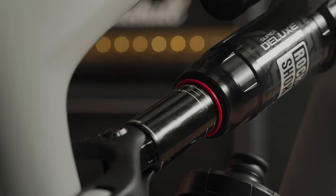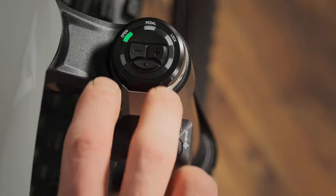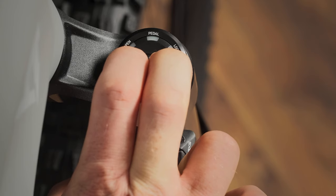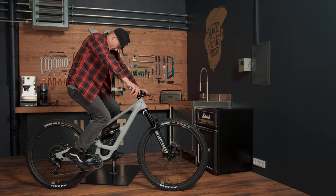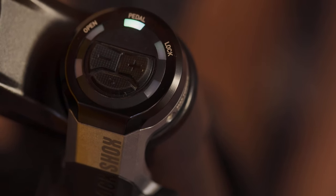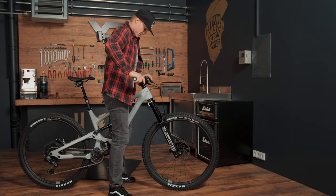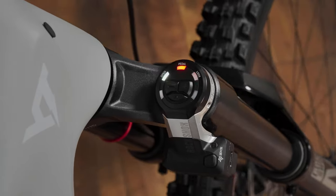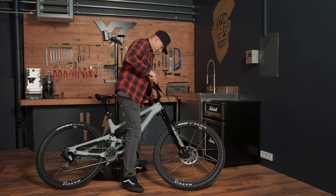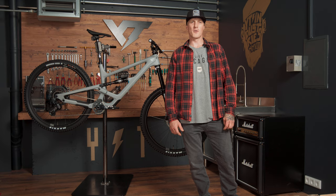Last but not least, we need to calibrate the system. Sit on the bike on a level surface in full riding gear to put both shock and fork to their set positions. Press and hold both adjustment buttons for three seconds until the pedal LED pulses white. Red LEDs during calibration indicate that the bike is leaning too much to one side and is not truly vertical — hold the bike vertically with straight bars until the LED blinks white. When the open LED pulses white, get off the bike and stand over it. Tilt the bike to the non-drive side with the bars straight and hold it steady. As soon as the open LED starts blinking quickly, the calibration is complete. The system is now set up in auto mode; the open LED pulses green and we are ready for our first test ride.